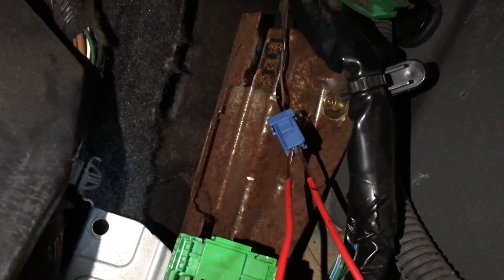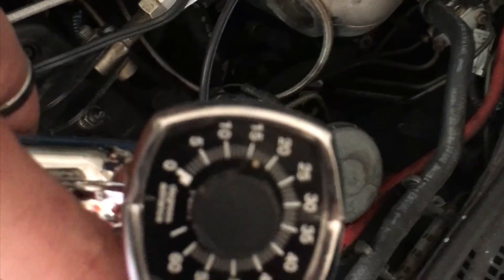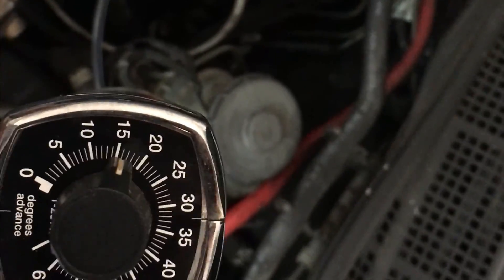There is the blue connector — that little green thing — wires are jumped and should be good to go. The jumper's in there, this is set at 16 degrees. Now we'll get her fired up. We're going to go ahead and loosen up the distributor bolts.